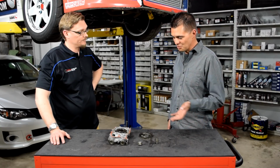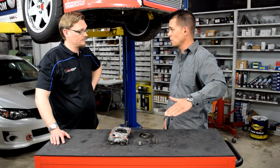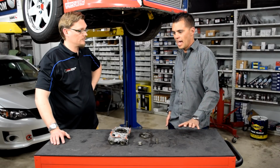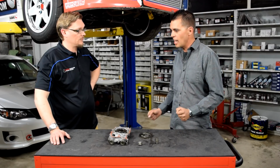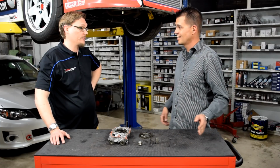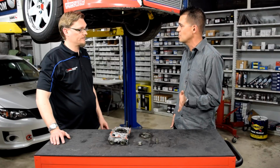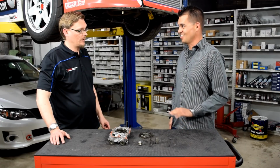Right. So you go on the internet, you see there's a lot of discussions. You do this, do that, 1,000 RPMs, 10 psi per 1,000 RPMs. Right. What are these pieces? So again, in my situation, what I was noticing at street temperatures, hot, and I think we find this a lot in the forums. People are like, oh, I see this pressure hot. Right. I really feel track temperatures and street temperatures are two different things. Sure. And at street temperatures, I thought, well, that's okay. I'm okay with this because my oil temperatures seem to be reasonable. I'm seeing 200 degrees to 210 on oil temperatures on the race car. But at track temps, I saw a completely different deal.